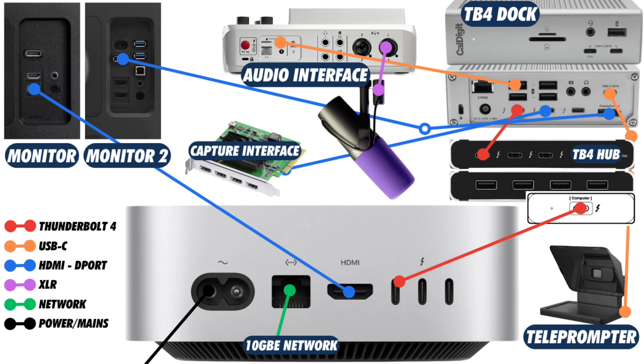Before setting this up, one of the first things I did was think about what I was going to plug in. I made a little chart in Canva — I highly suggest you do the same. You could do it with a pen and paper. Here's my Mac Mini chart: I know I'm going into my 10-gigabit Ethernet port because I have a 10-gig network, so I upgraded to 10-gig on my Mac Mini. Monitor one comes in through HDMI, and monitor two comes from the dock.